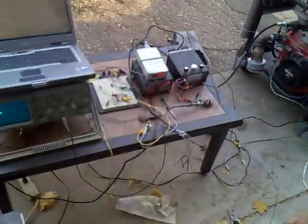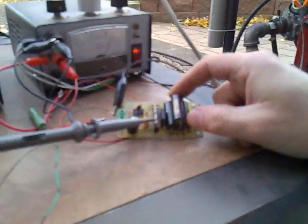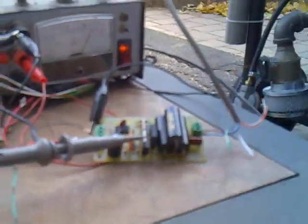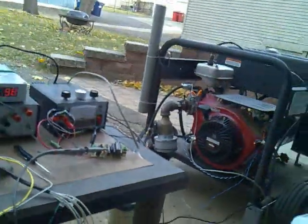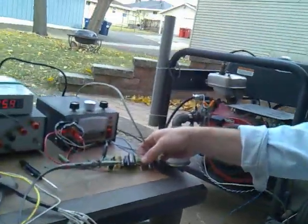Over here on the electronic side, I have a saturated injector driver with charge recovery, which allows me to open the injector much faster — approximately the same, slightly slower than a low impedance injector.